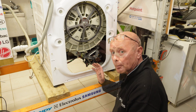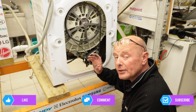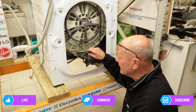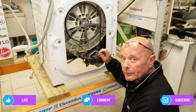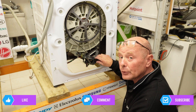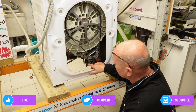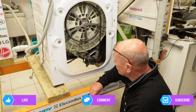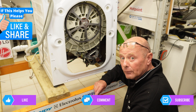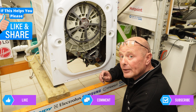We've put the belt on and now when we rotate the drum there is no ticking noise anymore. However, this doesn't necessarily mean the machine will work - we need to inspect the circuit board. When I plug the machine in, the pump comes on but the motor is still not turning, and I know this is a perfectly good motor. With the wiring diagram you could do a voltage test on the motor plug terminals - checking the carbon brush and field winding connections, which should each show 240 volts during their respective rotation directions. See our other video on bench testing motors for details.